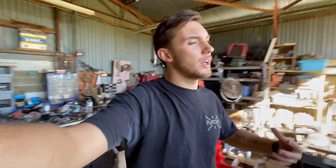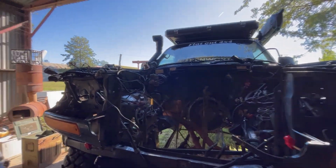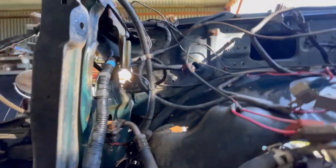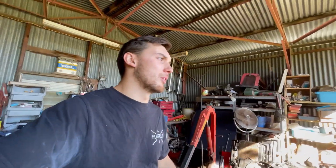We're back again — it's now the next weekend, just me out here today. The missus is in town working. Today I'm trying to get the engine bay painted. I've just cleaned it with hot wash so all the gunky crap from the power steering leaks is all gone and it's ready for paint. I need to fix up the damage from the second battery tray that was in it before I got it. Hopefully today I can also pull the dash out and replace the heater core because it went pop.